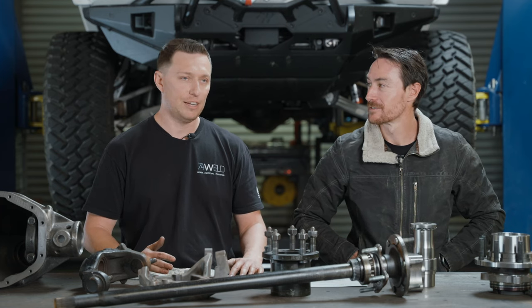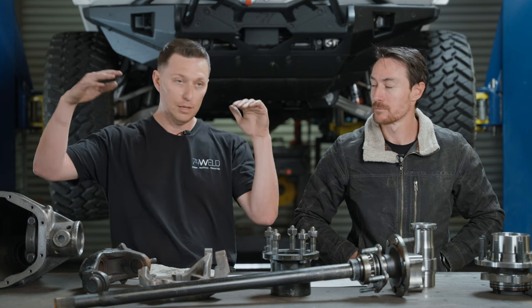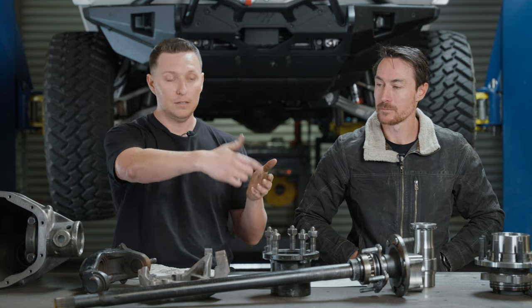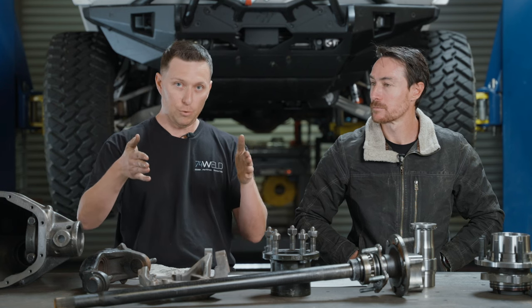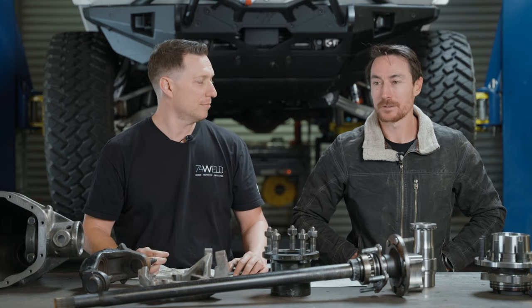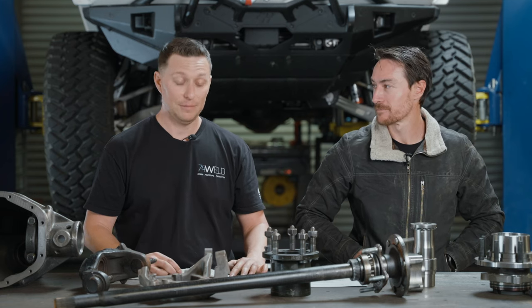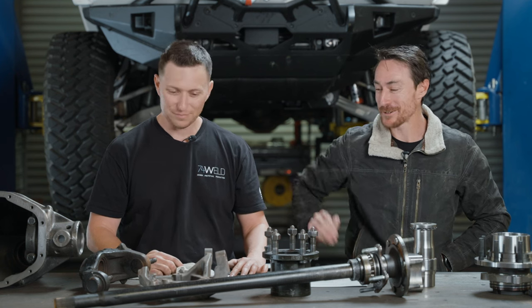There are some cantilever kits out there where, for packaging reasons, you have coil-overs in the frame on a pivoting arm with a link down to your axle — your coil-over springs are inboard of your frame and your links are very narrow. A lot of those kits are considered axle killers. That also affects suspension geometry, your instant roll center — it can have a lot of other implications. You're going to want a lot of sway bar with a kit like that.